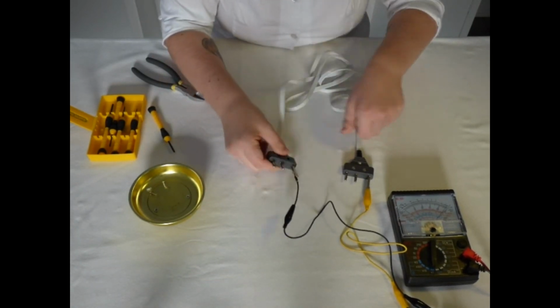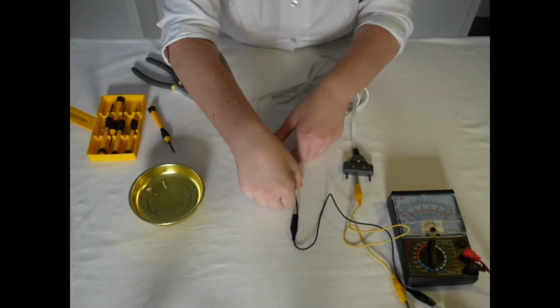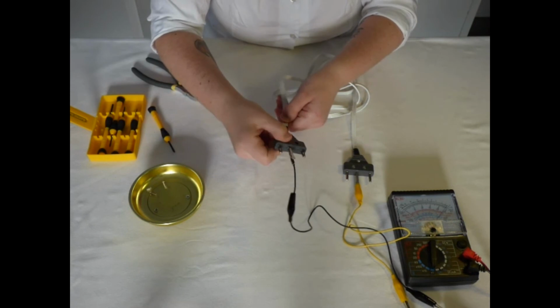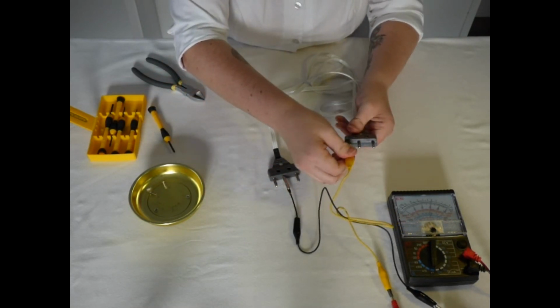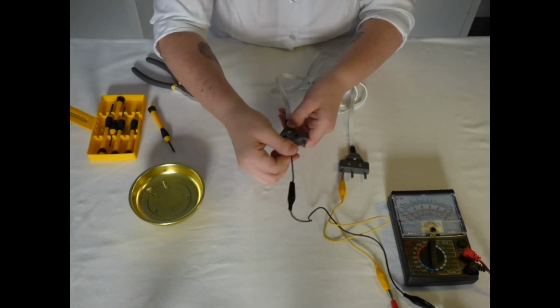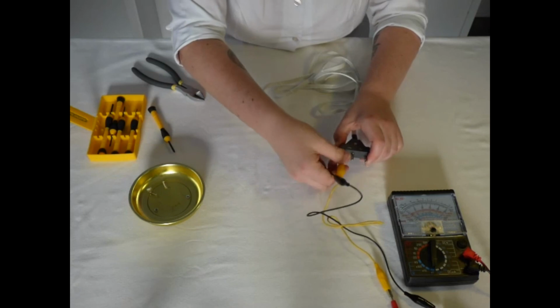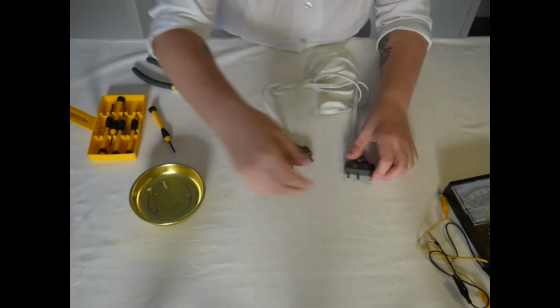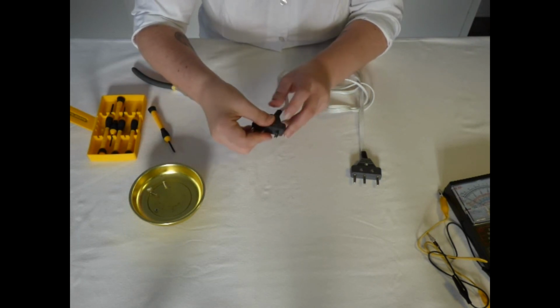And as with our diagnostics video, you could do a final wiggle check to make sure that you actually fixed it beyond where the break was, or that there wasn't a second break that you need to address, and everything is still in the correct resistance range. We have that here, so all we need to do is just finish putting the last couple of nuts and bolts in.